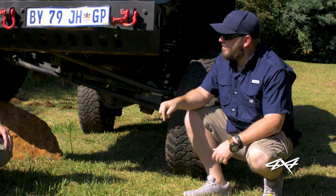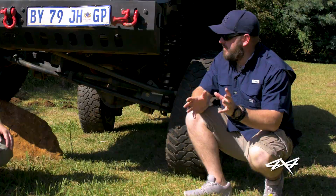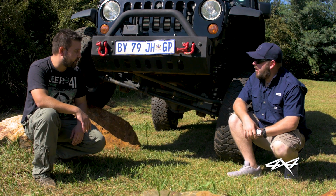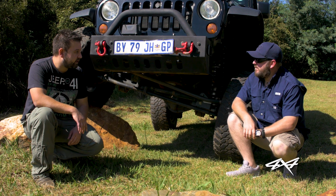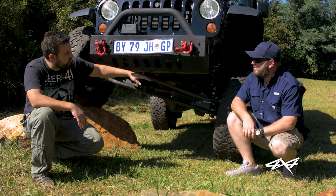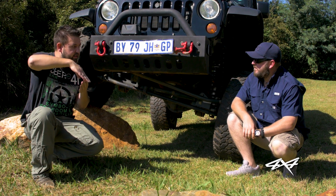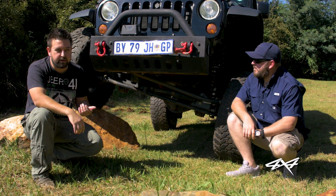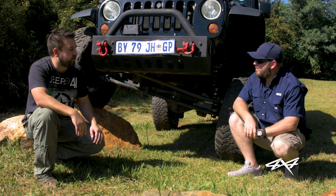And tell me, does that come with this Jeep or is it specific to modding it? It's a specific mod. So if you lift it over 3 inches or more, you generally need to have a flip kit. What it does is it just moves the drag link from the bottom to the top, so it just decreases the angle. You lift it, the angle rises like this, and you get bump steer, and the vehicle loses its stability on the road. So lifting it over 3 inches, you want to stick a drag link flip kit in, and 100%.